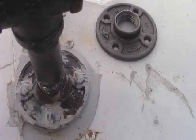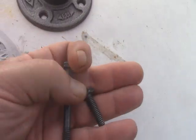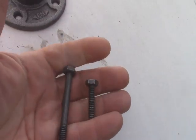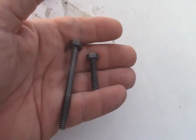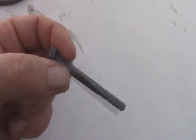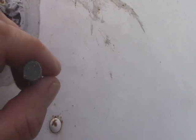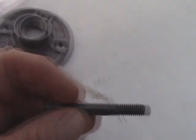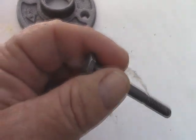I'm using grade 8 bolts — they might be grade 6 or something a little less — but in any case they're much harder than a standard bolt so they won't shear from the weight. Where my holes go through the rib, I need a longer bolt. These are two and a half inch — it's really bright out and I can't see the screen on my camera.